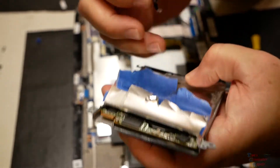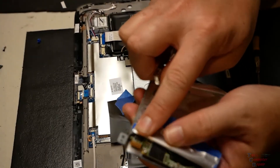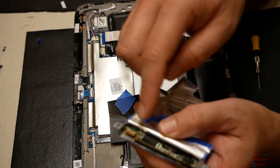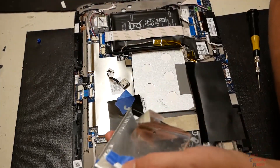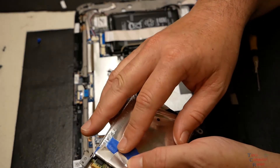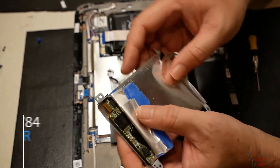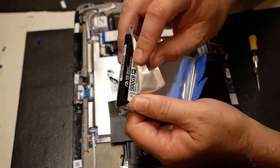This is actually a hybrid solid-state drive. I thought at the time that this was something proprietary that Western Digital did, similar to what they did in their external hard drives. What I have since found out is that this connector is actually called an SFF-8784 connector, and you can actually purchase this Western Digital SFF drive.